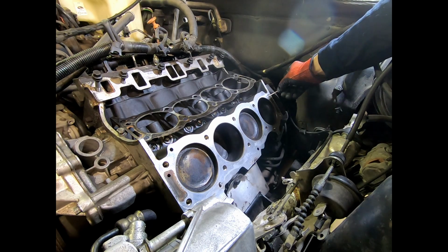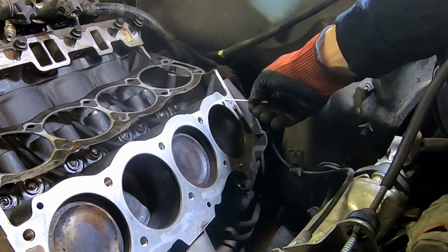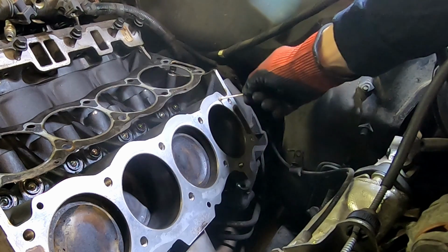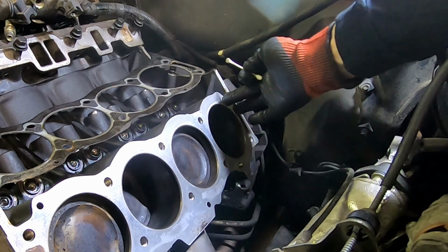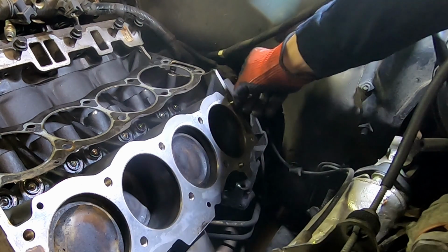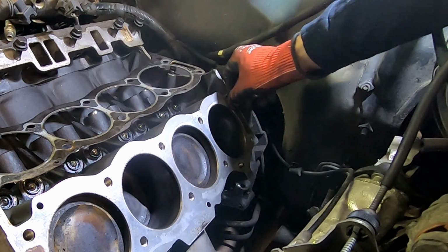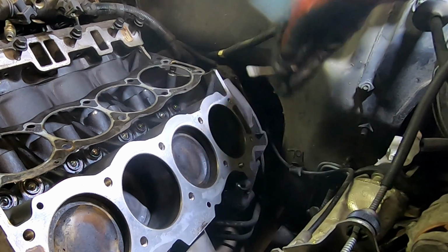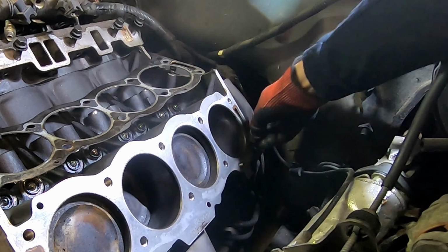This one also here, there's the oil port ends here. We talked about that earlier with the cylinder head, the blocked port that we found. As you can see, I got this surgically clean. There's no evidence of it at all. But same thing, this is above the coolant port. Kind of spiral out a little bit, not too bad. Bottom side, again, exposed to the coolant port.